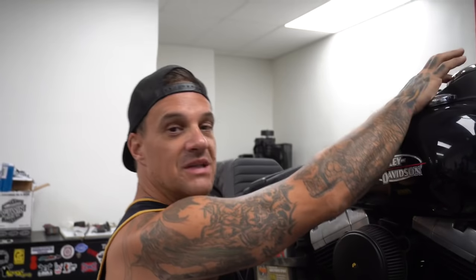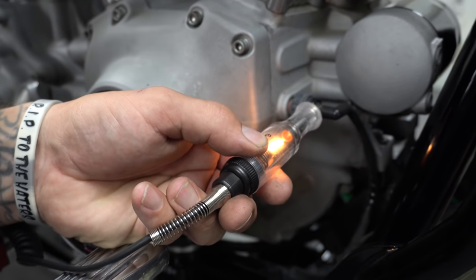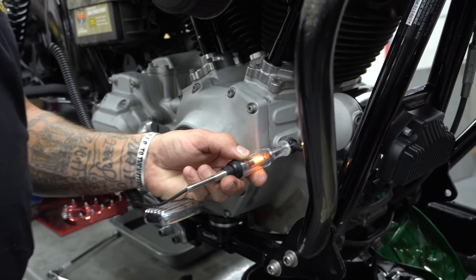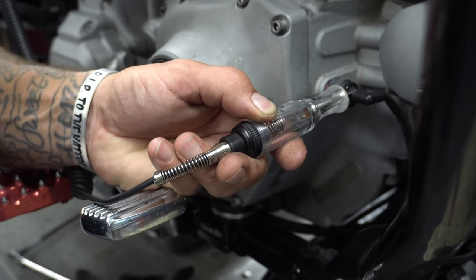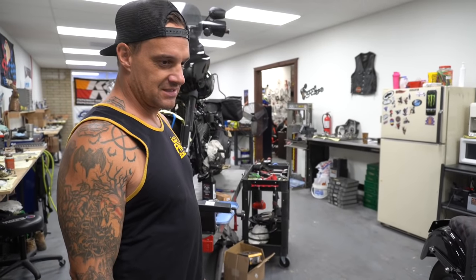I'm going to change the oil when I put the exhaust on, then prime it and go from there. Normally you just run off the dummy light, which shuts off at 5 psi of pressure. I don't trust those things, so I have a test light hooked to the positive of the battery and I'm going to touch the oil pressure sending unit — it's just a ground switch, so when you get oil pressure it kills the ground and kills the light. Pump this thing in short spurts so you don't burn up the battery. We got oil pressure — that means the whole cam chest, the oil pump, everything is primed full of oil. When we start the bike it's not going to be dry. Transfer and load a map in it, and we're going to take it outside and start this thing.